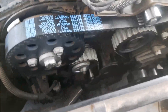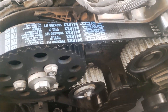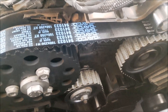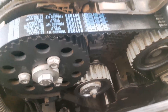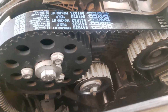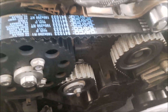I have installed the plastic cover. I forgot to mention that after adjusting the tensioner I have to rotate the crankshaft clockwise and check how the tensioner is adjusted, and also check if the locking pins go back in easily to the same positions where I installed them. I have checked and they are fine. I have also installed the lower plastic cover, so now I can install the crankshaft pulley.